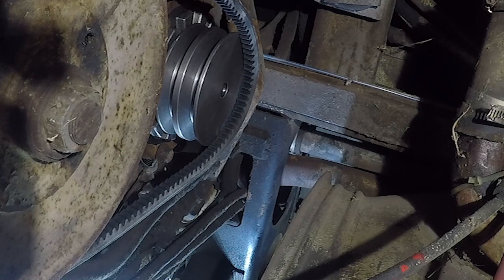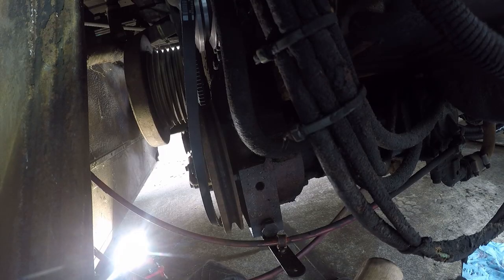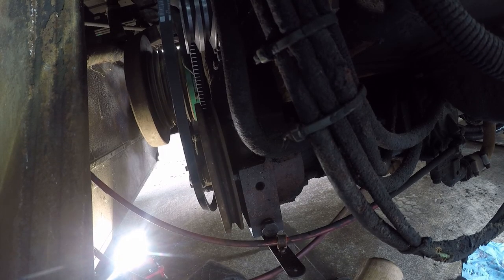So, there is a trick I could pull. Kind of hate to do it. But I could seat it on the pulley and then bump the engine to pop it into place, which I hate to do. But I don't see any other option. Lift compression release. Yeah, wrong direction. I'm gonna seat it here. And then I'm just going to run it around, and that's really not good for it. I'm actually going to do it from underneath. Here we go. Ghetto belt. Oh, shit, and it's twisted. What the fuck? There it goes.